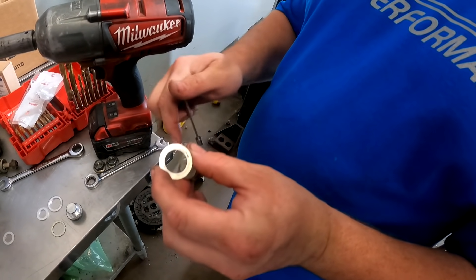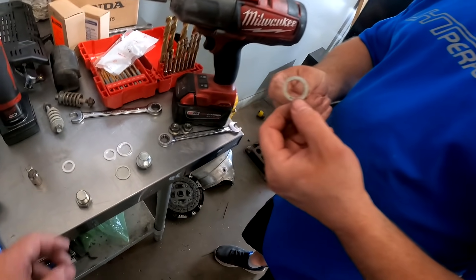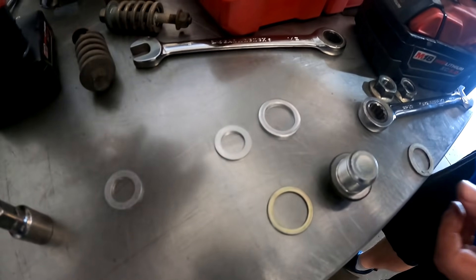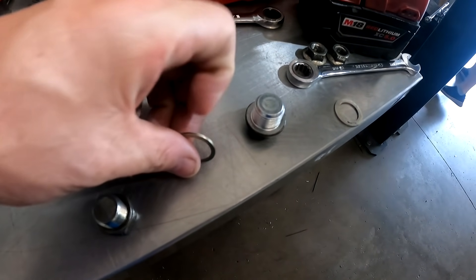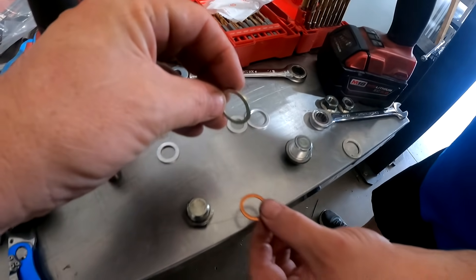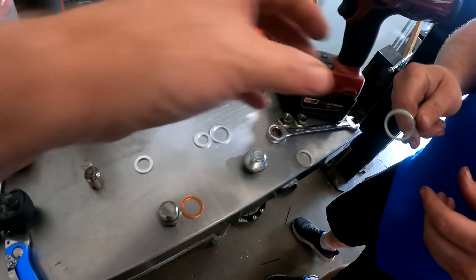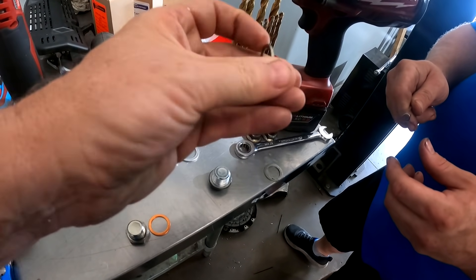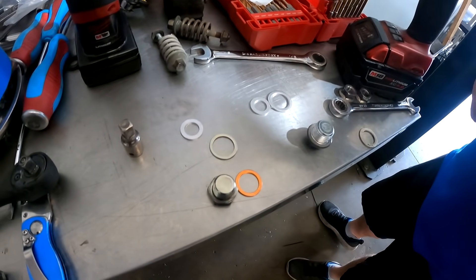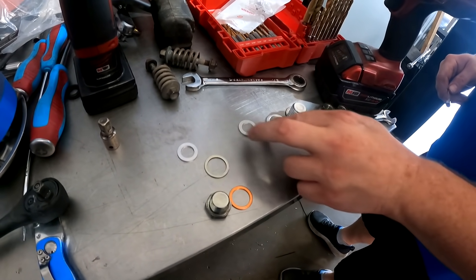This is just a regular washer - it should be aluminum to have the crush effect. These are the factory ones right here. There was another washer on there which is like a spark plug style crush washer - and it actually fell apart, just separated right there. Interesting things you see when somebody else has worked on a car and hasn't used the right parts.